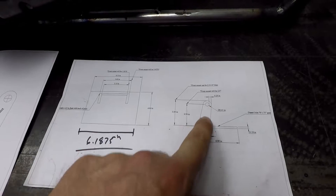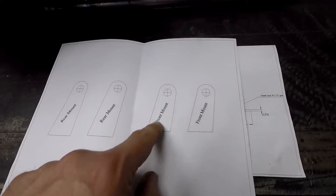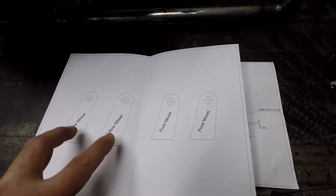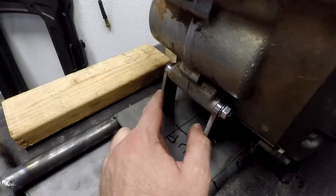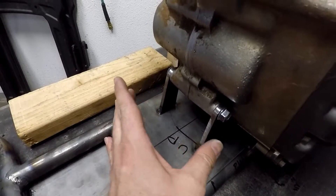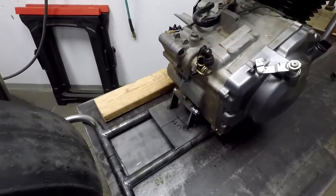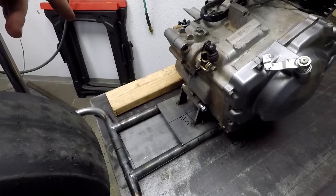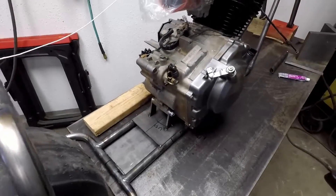There's a side profile with the tabs, and what I did was make life-size templates for the engine mount tabs. This is the engine mount tab that we saw on the drawing. These are going to be boxed in on one side — probably this back side here — and potentially gusseted. Those mounts are made of quarter-inch thick steel, so I think we're going to have plenty of strength in that.